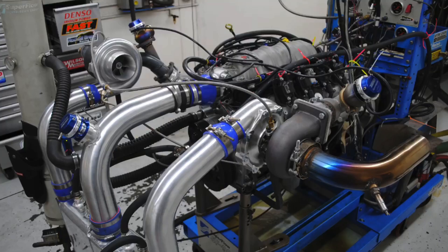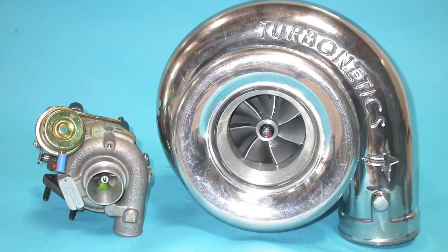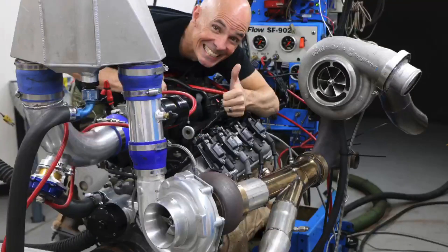You might be asking yourself what the heck is a compound twin turbo setup and how does it differ from other kinds? There are essentially three kinds of twin turbo setups. One is a conventional twin turbo where exhaust runs to two turbos that independently feed airflow into the motor. The second is a sequential system where a small turbo spools up first for instant response, then switches to a larger turbo — but the plumbing is very complex with valves on both inlet and exhaust sides. The third, which we did here, is compound, where one turbo blows into the other turbo, jacking the boost up into the motor.